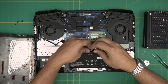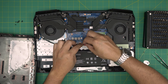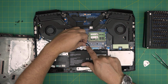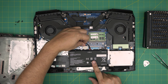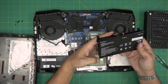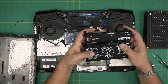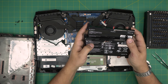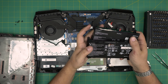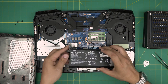Put the new battery in, twist it around and bring it over. However, this battery is the wrong model number — the jack connector is too big, so it will not fit through the connector. The client purchased this one but it will not go in. Even if the battery model name is the same, the part number is different, so make sure you have the exact correct part number before purchasing.